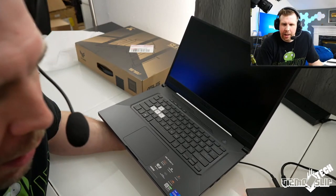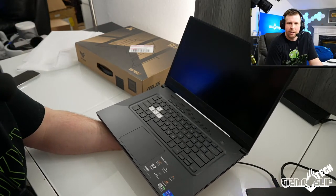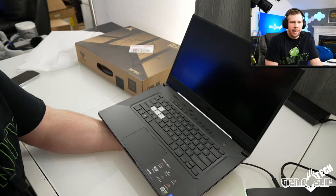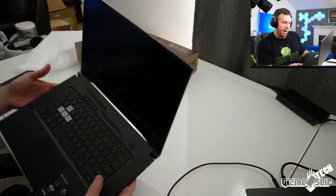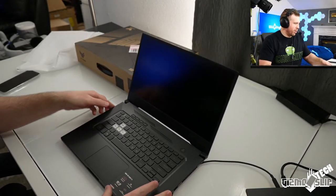If you plan on doing any dedicated GPU test to bypass Optimus, you need to go to the BIOS and switch the HDMI from the integrated GPU to the 3060. Yeah, I saw that in your video. That was really interesting, Steven, that you have to do that in the BIOS. It's interesting that you can even do that in the BIOS. That's the first time I've seen that. Though I imagine other manufacturers have probably done that.